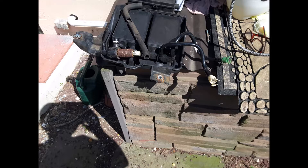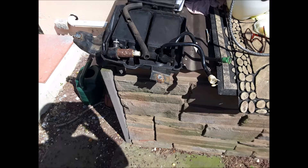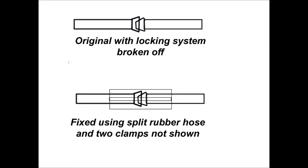To reconnect these two hoses later — one goes to the fuel tank and the other goes to the purge valve located in the front of the vehicle under the battery. Both connect directly to the charcoal canister, so it really does not matter which goes to which. Ford could have saved by using a T-fitting and only one hose to the canister. Once I busted those badly designed Ford connectors, I used rubber tubing spliced on one side in half to straddle over the two connections and secured it with a hose clamp on both sides.